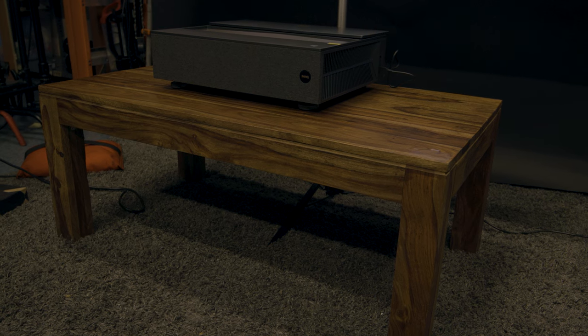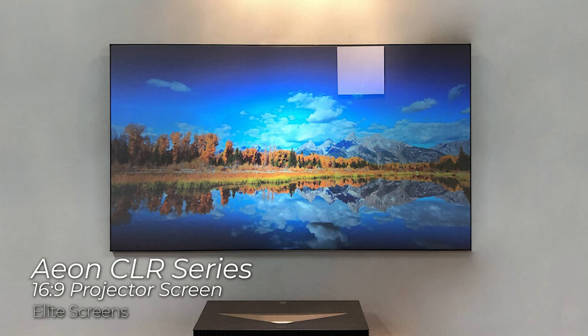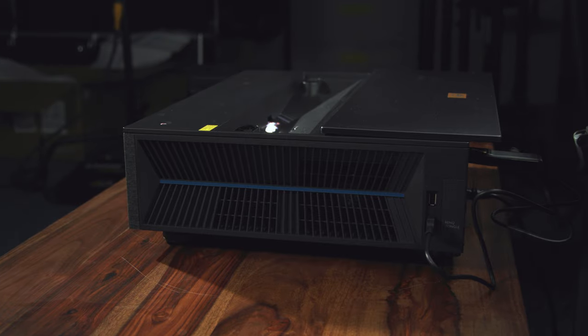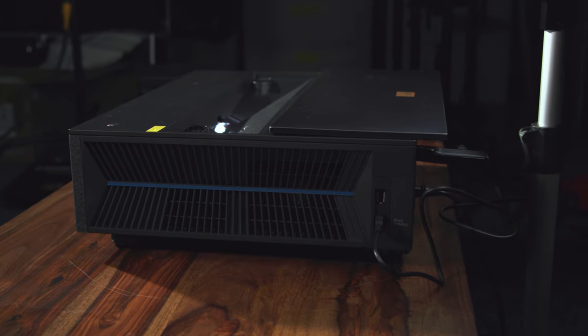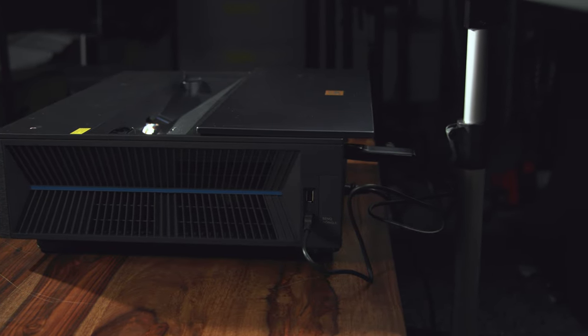How close was I able to get to our screen? Placement here in general should be fairly low to the ground, as you can see. I'm just using a white backdrop, which admittedly is really not the best way to view this projector. You should really get a screen designed for UST projectors that can also absorb ambient light, like the Aeon CLR screen from Elite Screens. Nonetheless, from the edge of the projector body to the surface of the screen, I was able to get about 11 inches away, which gave me a screen size of just over 95 inches horizontally.